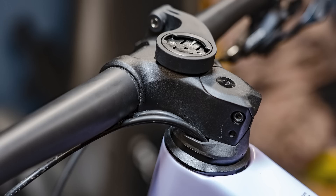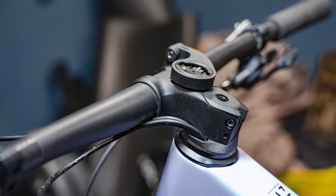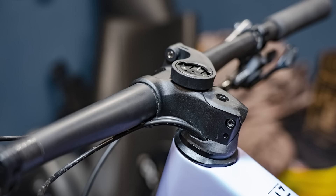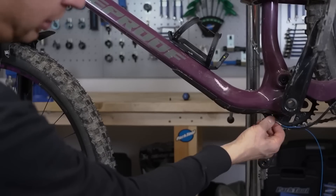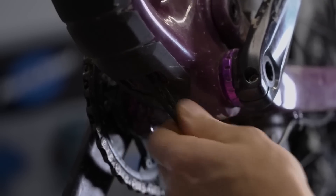What do you think — are there any pros and cons that you think of straight away? Pros: looks cleaner, doesn't it? No more cables hanging out the front of your forks, banging and chattering away — it all goes internally. But I dislike it when it comes to maintenance. The whole point is to make it neater, and manufacturers being able to put cables through the headset, not through tiny ports in the head tube, means you can make a stronger and lighter frame, and it should be less fiddly. Pushing cables through a big open headset should in theory be easier, but what you gain you sometimes lose with designs that require fiddling around with spacers.